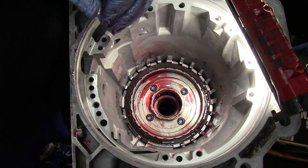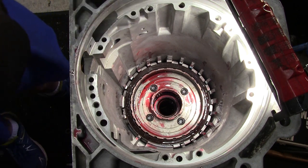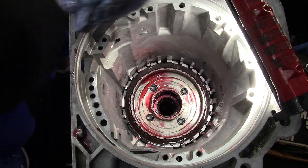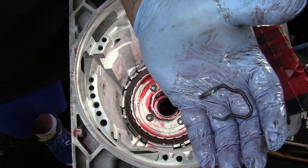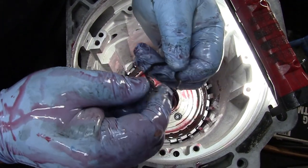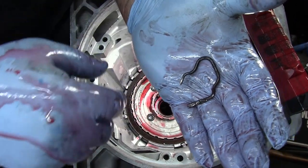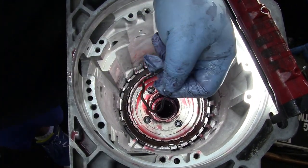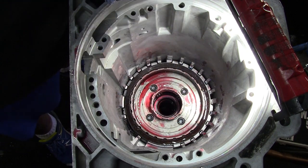Now that you've got your clutch built, you need to put your spring in there before you go any further — your anti-rattle clip. It's a spring. You can put it in afterwards, but it sure makes it a lot easier to do it now. This doodad here — it keeps it from going clunk when you put it in gear. This thing has got a cutout on this side right here. There's a spot in the case more towards the bottom where that thing will sit. So just put it in there like this — just like that.